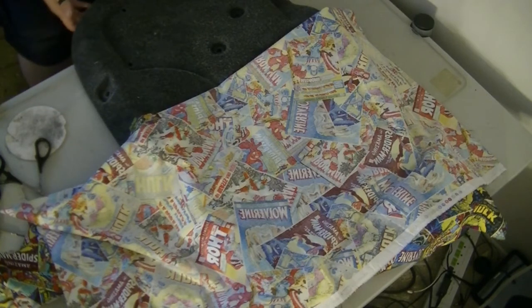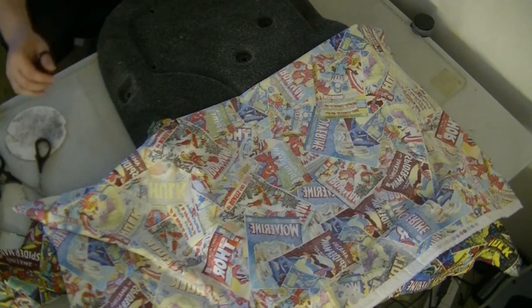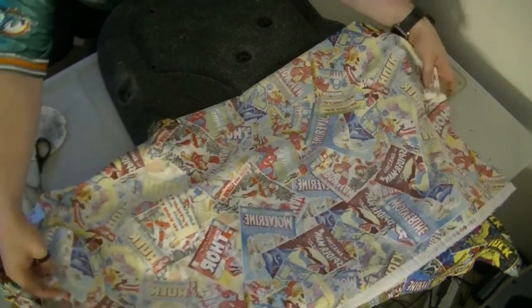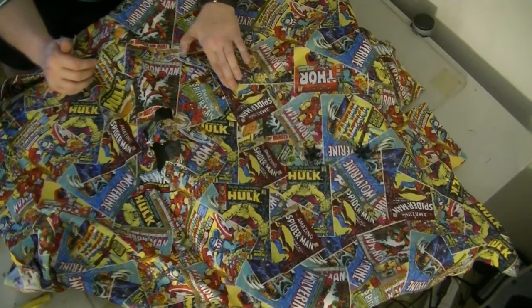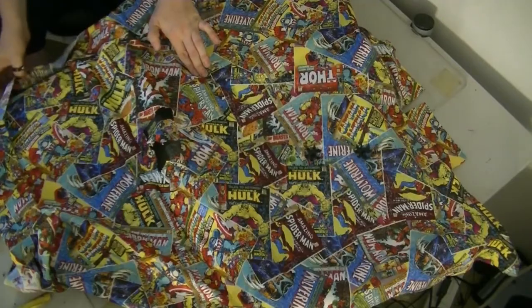So now I've got it. See, I really didn't like this idea. I did find my 27-year-old other can of spray adhesive. I hope it still works if I need it. Alright, so I'm just going to do like I did before. I'm just going to grab it, roll it back on. And when we do it like this, you don't want to set it down or lean on it too bad. Especially get it in your creased areas where you know there's going to be some shrivel.